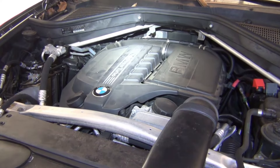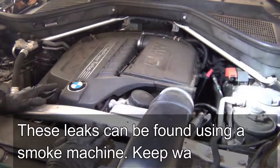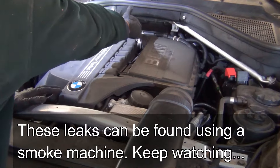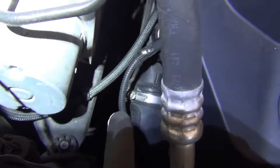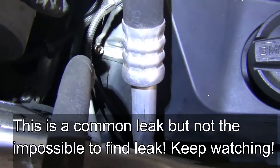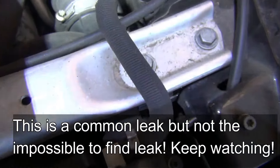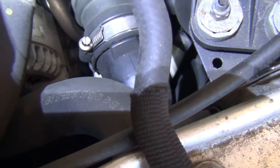Like any unmetered air leak fault, you definitely want to start with a smoke test. Let me go over the normal air leaks that you'll find when you're smoke testing it. You smoke test it right here with the air box off. You put your feed in here — sometimes you'll find a leak here, sometimes you'll find a leak down here. At the inlet pipe — here's the oil fill cap, so right here is the inlet pipe. Here's this pipe that comes up and comes down here, goes to the turbocharger. That's a common leak right down here at the clamps. Sometimes you have to replace the pipe to get this to stop leaking. Sometimes the inlet pipe here that goes down to the throttle will leak — so check that, but you'll find that on a regular smoke test.